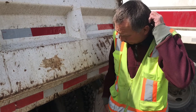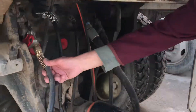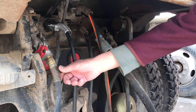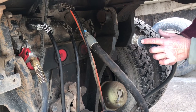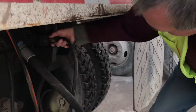When hooking the pup up, you've got your supply hose and the blue one and the red one. The red one supplies air to your trailer; this one supplies air to your brakes. When hooking these up, I want to make sure the glad hand gaskets are in good shape — not cracked or broken, they're all intact.